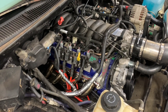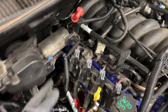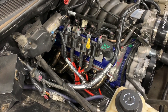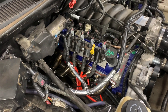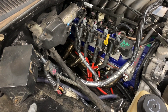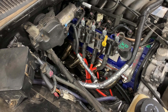A lot of people asked me about the coil pack brackets, because obviously the factory ones would hit back in here against the firewall — you couldn't get them mounted. And some spark plug wires to go with your headers. If you use the shorty headers I suggested that you can get for like $85, the factory spark plug wires that go to the coil packs — if you use the 5.3, 4.8, or 6.0 — those wires aren't going to fit very well.